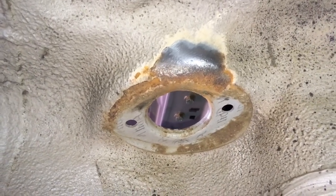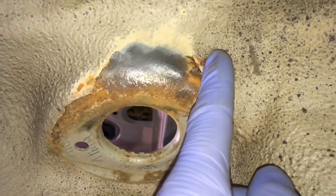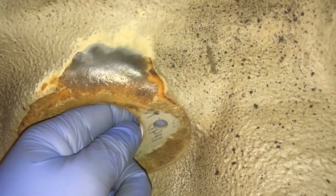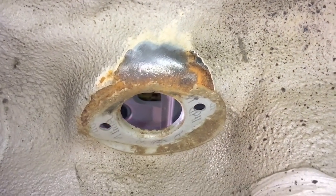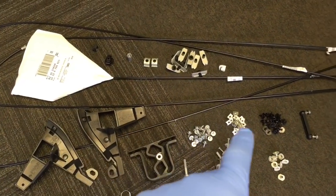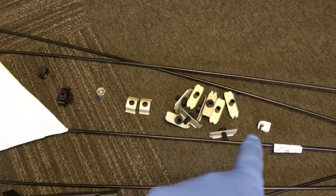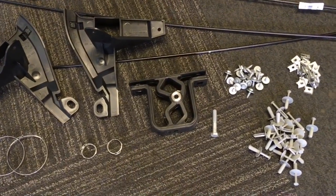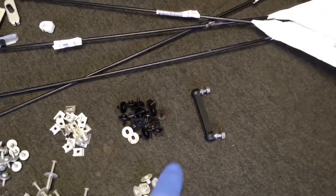Now in the wheel arch, taking the corrosion off the shock absorber turret where the top mount sits — terribly corroded. You can see how far I'm having to chase this to find some clean metal, and look, it's just lifting as well — it's been there for ages underneath the seam sealer. If left it just creeps and creeps. This is a really thick panel — almost 2mm thick — but what's the point of having rust there? It seems sensible to sort this all out while we're painting these arches anyway. Here are some of the pieces we're replacing on this BMW E46 M3: genuine BMW metal brake pipes front to rear, the short over-axle one as well, clipping point brackets, flexi spring clips, the joiner, the three plastic pieces, new aquaplane guards for the rear, one exhaust rubber mount plus the through bolt, copper nuts, steering tie rod gator clamps, various fixings, and the rear xenon drop link level sensor.